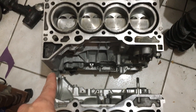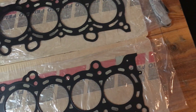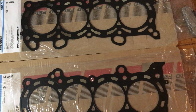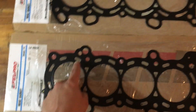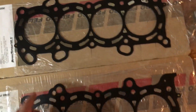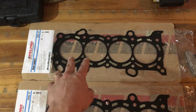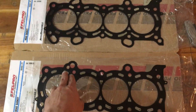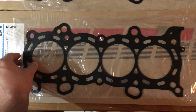Looking at the comparisons, you'll see that most of the portholes and coolant passages all look the same on both blocks. Going back over to the head gaskets, you can see there's a slight variation on the K24 — there's a little divide on one that isn't on the other — but if you look at where the bores sit, the shape and size are virtually the same besides that one difference.